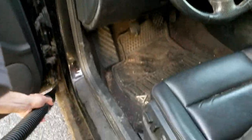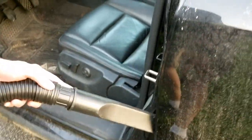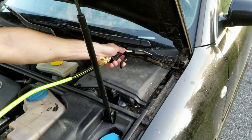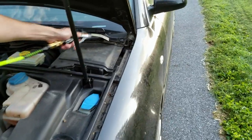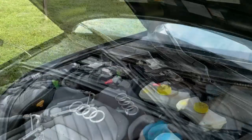You want to try to get all the loose stuff off so that when you go to wash it you don't end up grinding it into the paint. Next, I like to use compressed air to further clean these areas and get off as much loose dirt as possible. This helps, but this stuff is so stuck on I'm going to have to get more aggressive. I'm using one of the new quiet Harbor Freight air compressors with a blow gun and about a hundred pounds of air pressure.